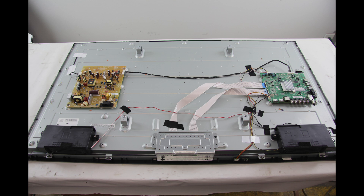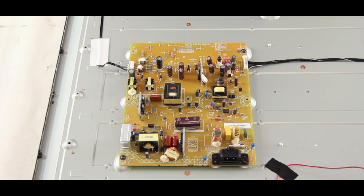I have begun by removing the screws and the back cover off my TV. We will be running the test on the power supply slash LED board here on the panel. We have highlighted this board in the video. Here is the cable connection that runs from the power supply to the LEDs. I will be checking the voltages at this connection.